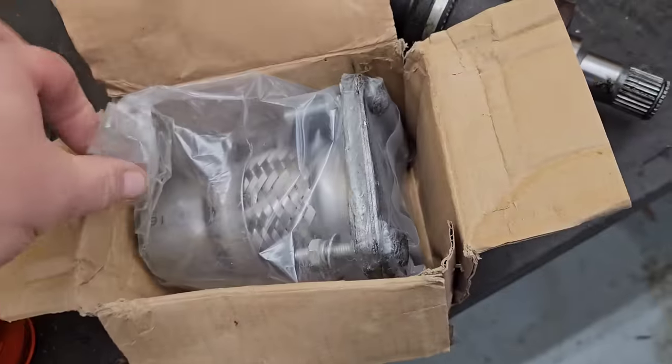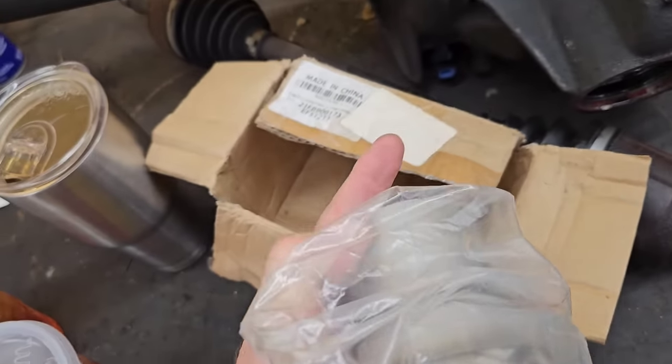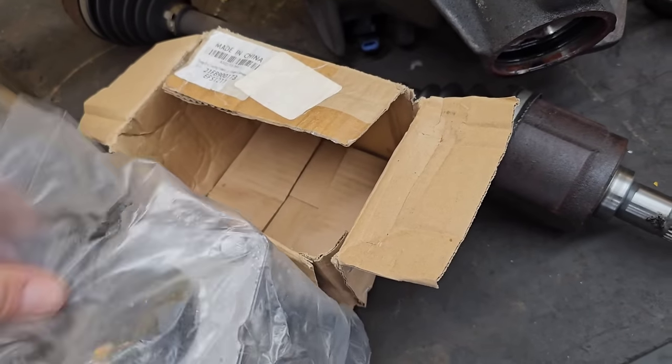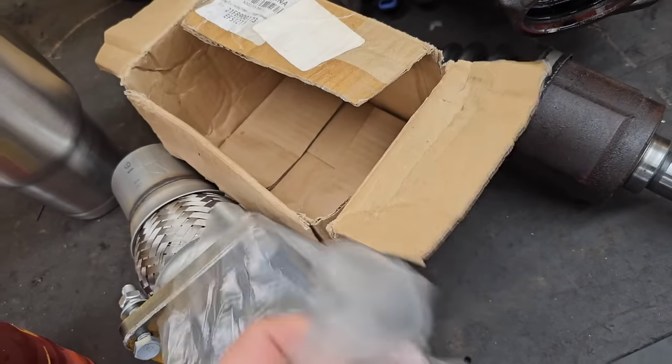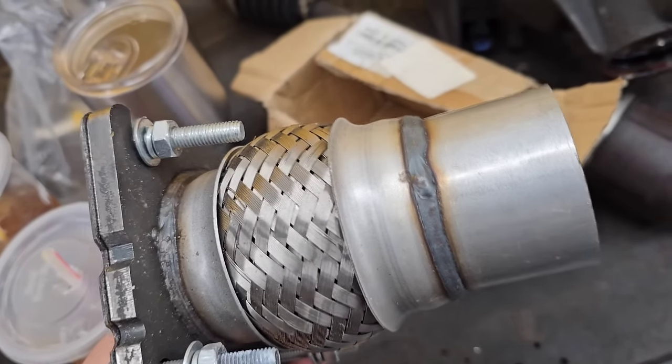This upper flange — the original factory flex pipe that is in this flange is what's leaking. As you can see, I've had this replacement part on Amazon probably two or three years ago when it first started leaking and I just never got around to it. So here it is. The problem is you've got to weld it in place. If you don't want to do this, you have to replace the entire catalytic converter. Why do that? There's no issue with the cat — 250,000 miles now and the cat's still going good. So we're going to leave the cat alone, other than we have to cut that out.